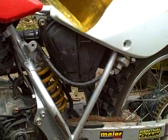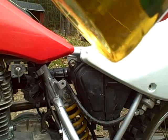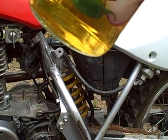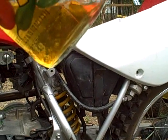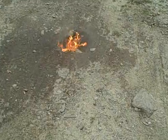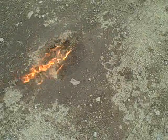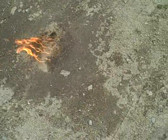This fuel doesn't smell stale to me, and I've drained off significantly more and there's no trace of water in this fuel. That little bit of stuff I saw in there might have just been what was in the bottom of this jar — maybe condensation. I thought the jar was dry when I took it out. I poured a little out of that jar on the gravel and threw a match on it — that's volatile. That did not indicate severe water contamination being my issue here.